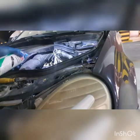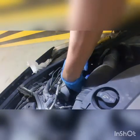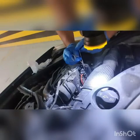Here I'm using the contact cleaner. Before I go any further, now basically you have to pull these two broken rods out simultaneously to get the connector out. And this also will be tricky because if you break it inside, it's either gonna be stuck closed or you will not be able to fit it back, so you have to take your time as well here.